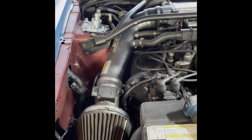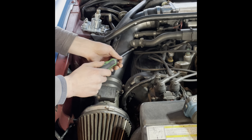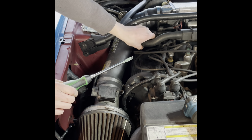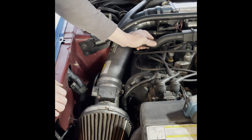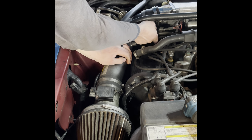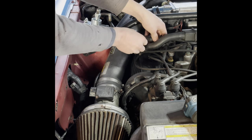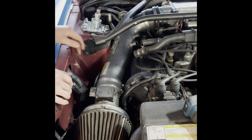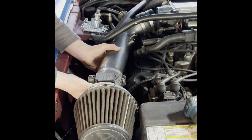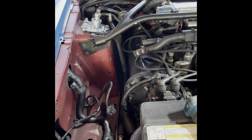And the main reason I went ahead and did this, although it should have already been done, is because I'm about to get the equipment I need to do some live tuning on this thing. That's the last thing I have to have before I do aftermarket cams, because I want to be able to tune it after I put the cams on. I just have PI cams in here right now, not really too aggressive aftermarket ones. And to do that, I need to be able to tune it. So I didn't want to tune it with the intake air temps I have now. So I'd rather get this swapped out and then do the tuning. That's the piece.